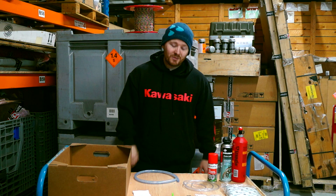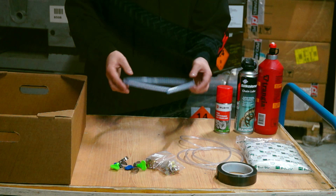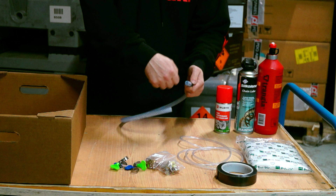I'm going to explain what I now carry to protect myself against a split fuel pipe. The most obvious thing you're going to need to repair a fuel line is fuel-resistant, heatproof hose. I use this one — it's braided, it's heatproof, it's fuel resistant, and I've measured it to make sure it fits on my fuel pipe.